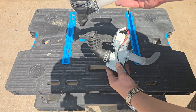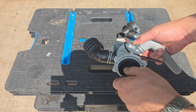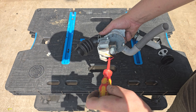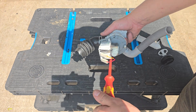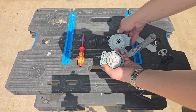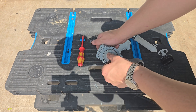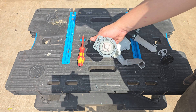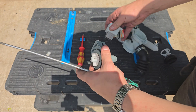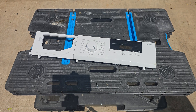The drain pump does exactly what it says on the tin — it pumps water out down the drain. It connects to a sump which is connected to the tank. Remove this filter cap — this is where all your blockages are going to collect and it's probably the most common fault you're going to run into with washing machines. This is the impeller — it's magnetized and should bounce back when manually spun. The bulk of the pump is an electromagnet; when current passes through it, it attracts the magnet on the impeller, spinning it and forcing water out.